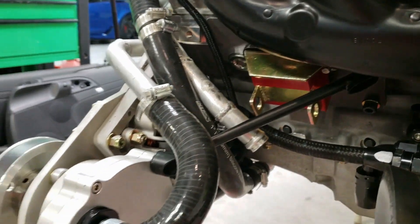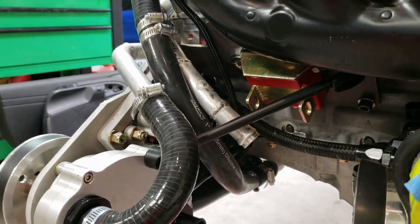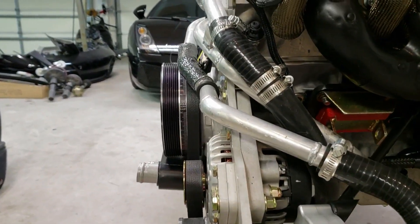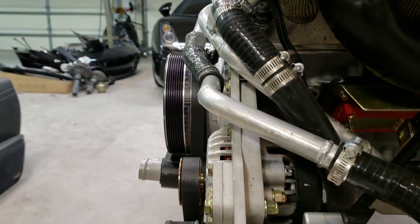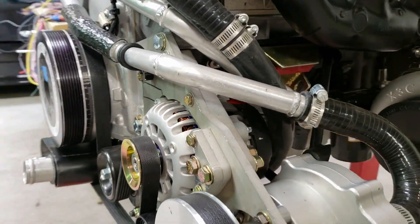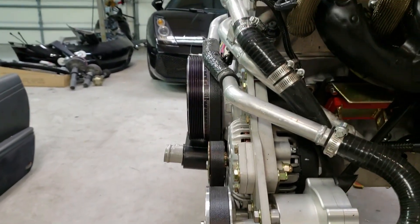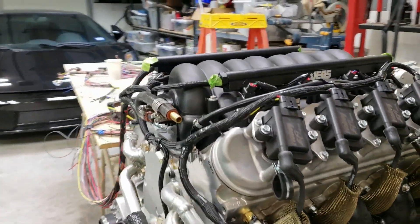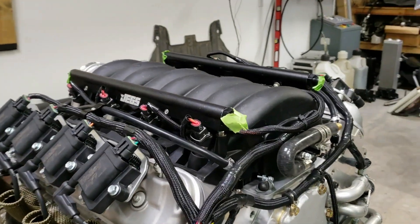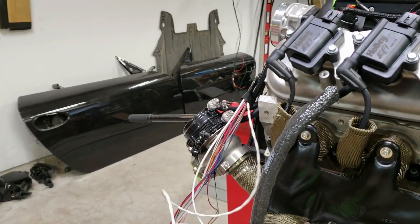It's pretty tight but pretty easy to work on. You can see this brace at the back of the accessory drive. The wiring is not finished yet — I'm going to mate the transaxle before I finish the wiring, because the wiring is going to go around the transaxle real tight, especially in the back. All this wiring will be wrapped and go down and around the transaxle, so you won't see it when it's in the car.